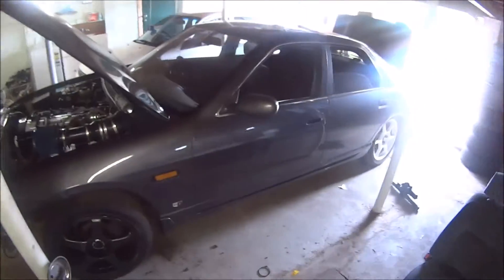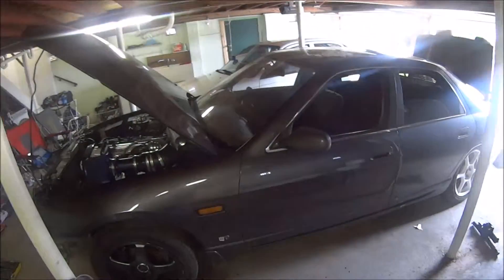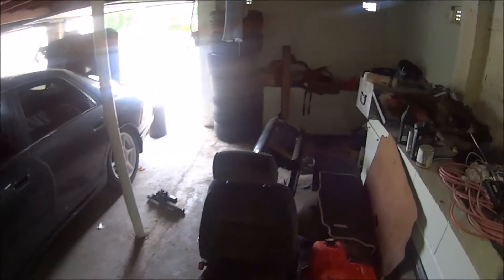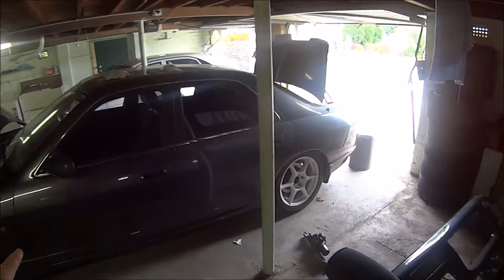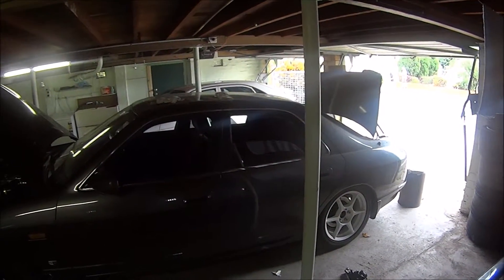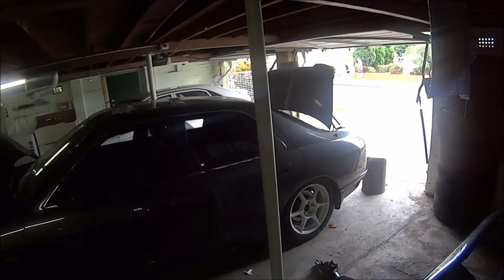The eyebrow height is lower at the rear than the front on these - I think it's 10 or 15 millimeters longer. You can look that up online, it's pretty easy information to find. I simply adjusted them to about 10 millimeters lower than an R33 GTR spec.